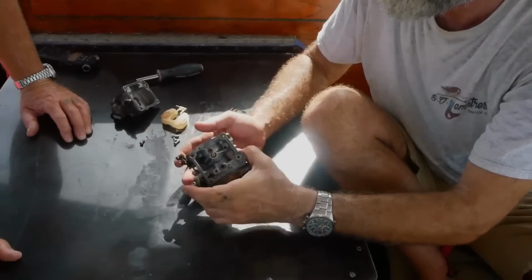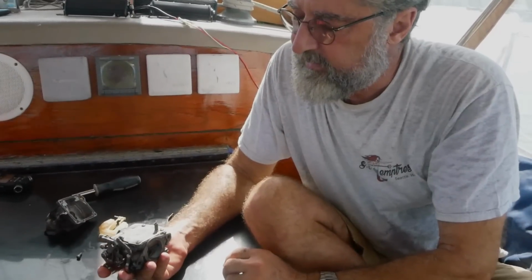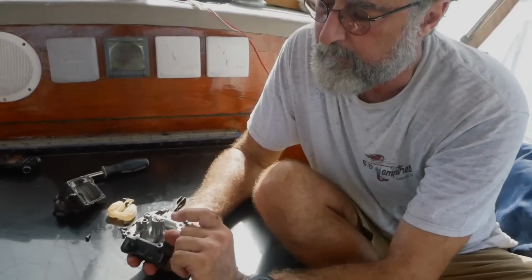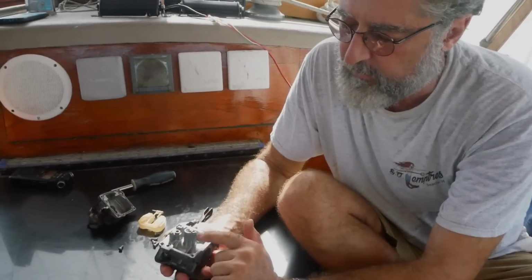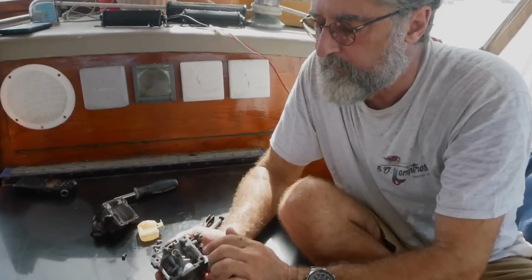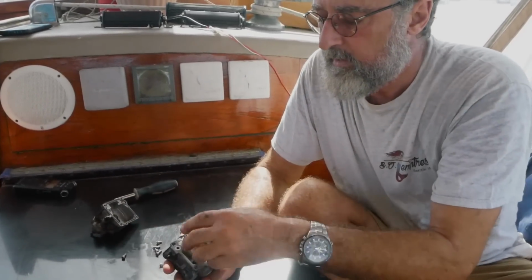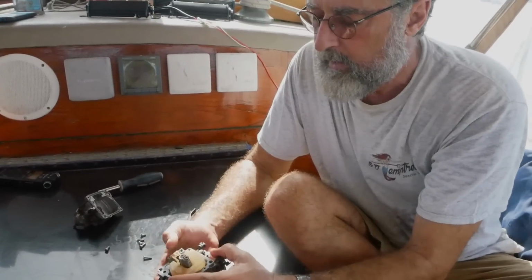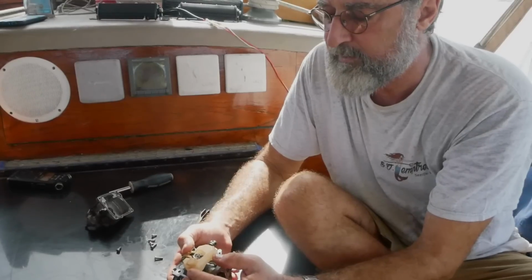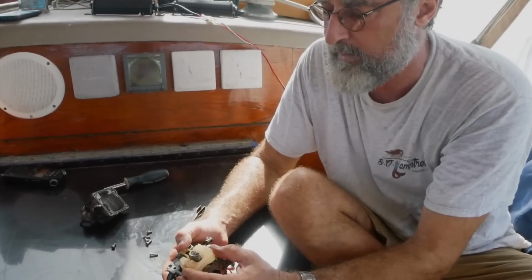Okay, well, let's talk about the carburetor. It rides this way in the engine, but I'm going to turn it upside down. So everything's upside down. There's a bowl of fuel, and the bowl of fuel has to be kept at a very, very consistent level. Like you could draw a line, and fuel must go to here. And how that happens is this float is in here. And remember, it's upside down, so when there's low fuel, the float is in this position, and when there's high fuel, it's in this position, and it tries to just keep it right there.